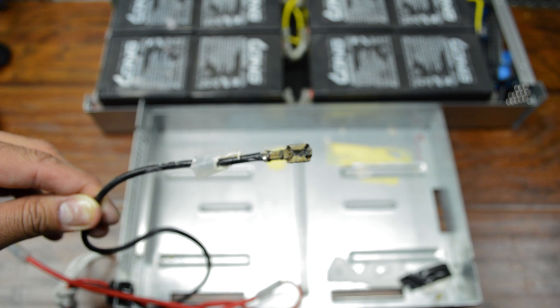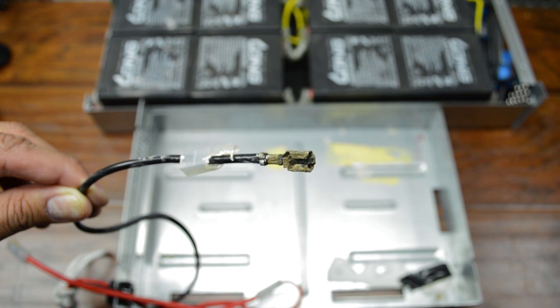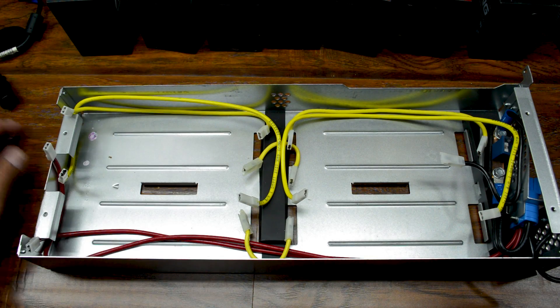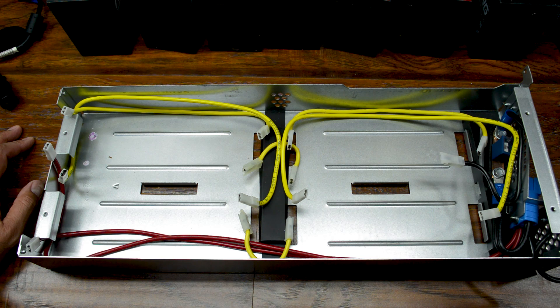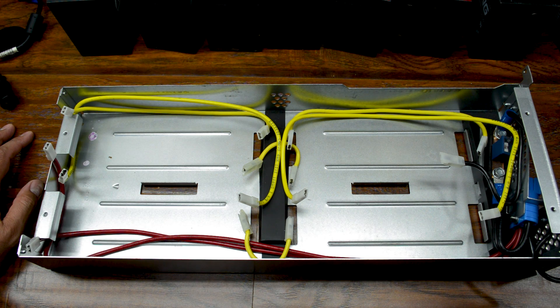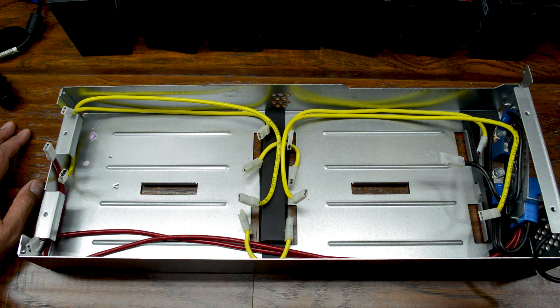At the moment I've got two bad UPSs, and I just need to make sure that I get one up and running before I go away. I think I lucked out — the bottom of this caddy is nice and clean, so that's a good thing. There are a couple of terminals that I noticed had some corrosion, but not anything as bad as the one I just showed you. I can probably just take care of that and clean those without too much of a hassle.